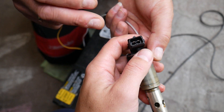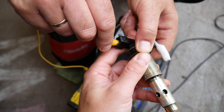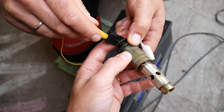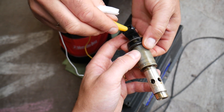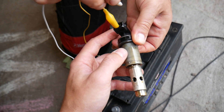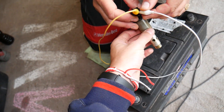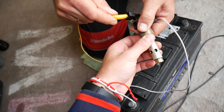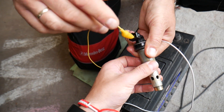You have only two wires, and it doesn't matter if you install the positive or negative on the left or right side — you can reverse them. But it's super important not to touch the two wires together, because if you do, that Vanos solenoid will be destroyed immediately and you'll need to buy a new one. So gently install the alligator clips — they are super handy. We'll put the link in the description below where you can buy them, as they can save you quite a bit of money.